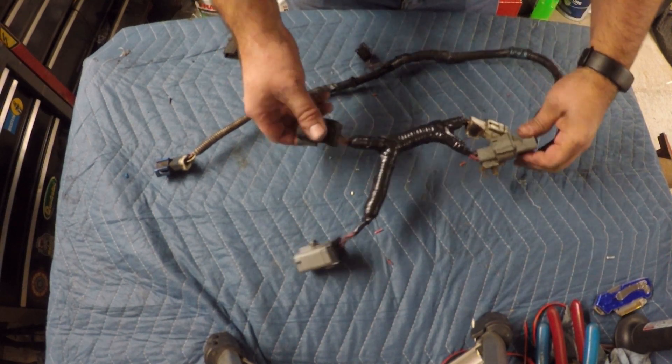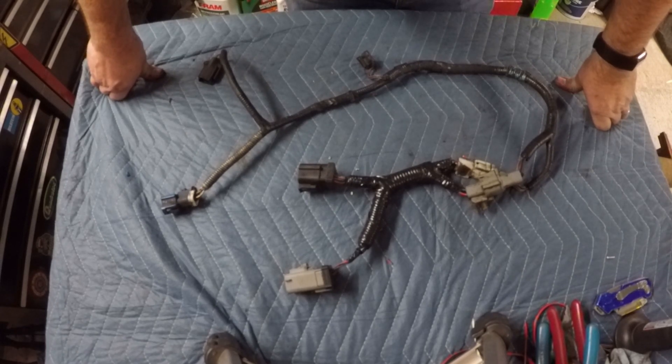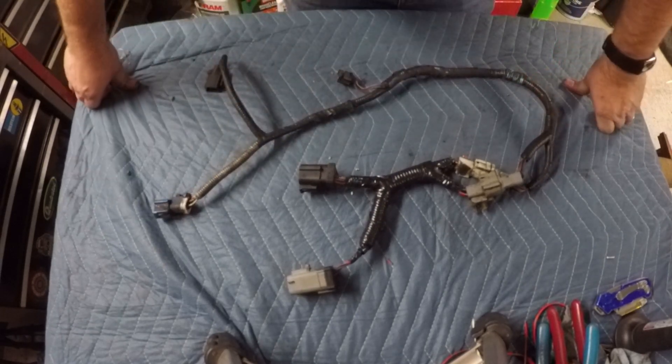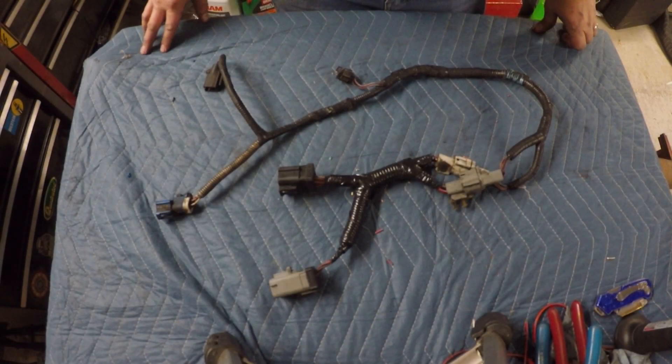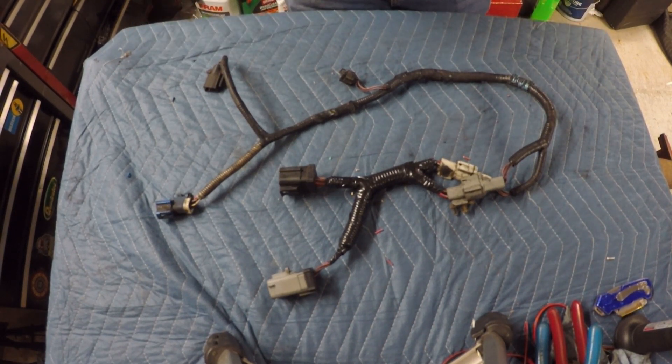The adapter harness is complete. You can see here I have it plugged into the manual transmission harness. I did take it out to the truck and plug it in, and was able to verify that it will start the truck with this in place. I also verified the function of the backup lights. I didn't actually start the truck since the transmission is on it and the starter isn't connected properly, but it looks like it works pretty well. This is definitely a solid option over swapping out the entire engine harness, and I made it in far less time. I will still have to deal with the clutch position switch issue — right now the truck will start regardless of clutch pedal position — but I might address that to make it function correctly, and I'll talk about that in a later video.